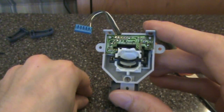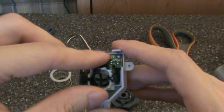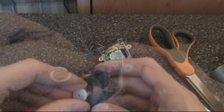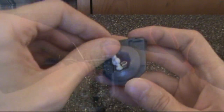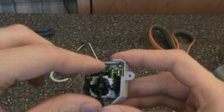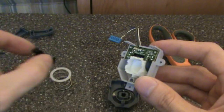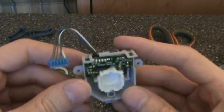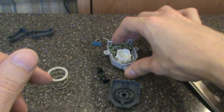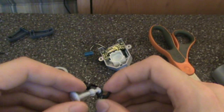The problem, however, are the motion bars. The control stick wears against them, shaving off all that controller dust and eventually making the stick thinner. When you're moving the control stick, the analog well gives you a clear boundary of how far you can push the stick, which is supposed to be the extent of the available movement of the motion bars. But when the stick is too small for the bars, it takes more pushing for the stick to make contact with them, so you reach the edge of your available movement before the motion bars reach their limit. This makes it more difficult to make precise movements, and makes running at top speed nearly impossible.